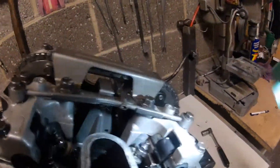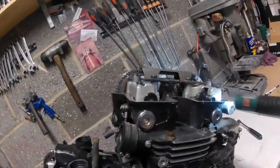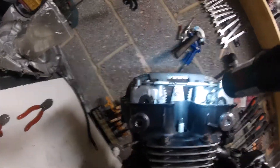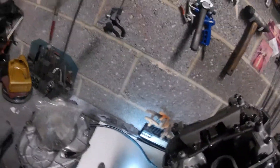These are superseded cams — there are, I believe, three different sets of cams for this engine. Different versions that Honda tried to cure the problem with getting oil in. I do believe, correct me if I'm wrong, that these are the latest ones. So again, back to our line: we've got a straight line through the rear cylinders at top dead centre on one and three, coming out to the front — the same lines again through that side of the cam, that side of the cam, and that side — all in a straight line.